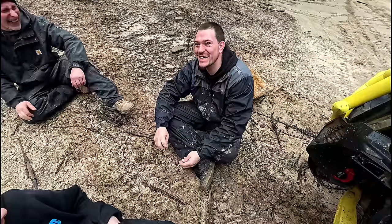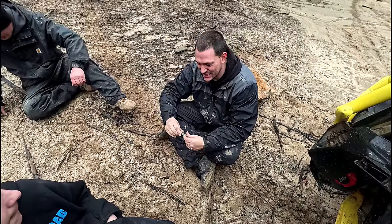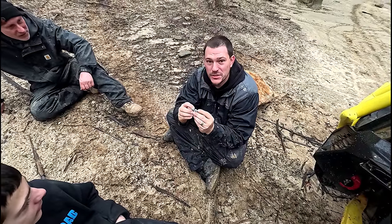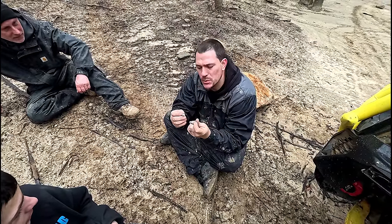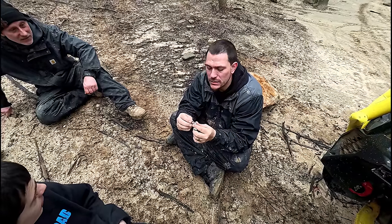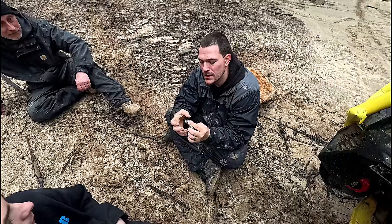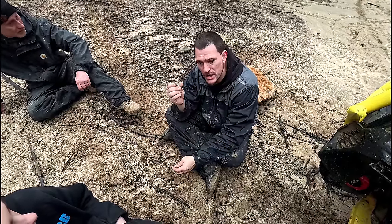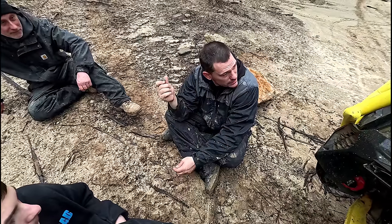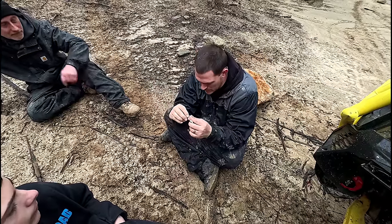Sick burn. Dude, that was rough. But I liked it. Man, honestly, yeah. We're going to blame this on operator error when installing our new diff that we're testing. I ripped the bolts out. I'm going to assume that I didn't have them maybe in or tight and they pulled out. Not really sure. So I think what we're going to try to do is run back to camp. Scott has a tap and die set. Tim has a drill and some drill bits. We're going to see if maybe we can drill it out because I ripped some aluminum out.